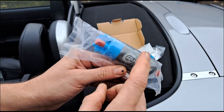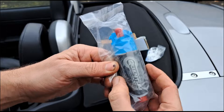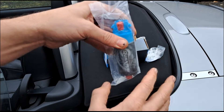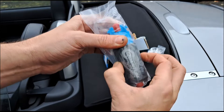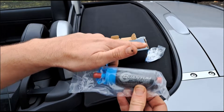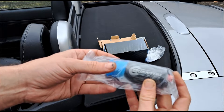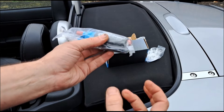There are a lot of Walbro pumps used in MX-5 Mark 1s and Mark 2s, but they actually go into a plastic canister within the car. The Walbro that's widely available at around 260 litres is a 39 millimetre body, and annoyingly you need a 38 millimetre body — which is why there aren't that many pumps out there for the Mark 3. I believe the Quantum is one that fits; I haven't used the DW range before but I've read a few things on the forum that made me stay away from them, so I've gone for the Quantum 38mm which should fit straight into the plastic fitting.